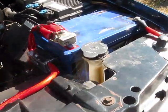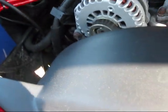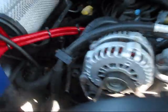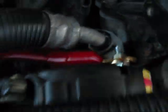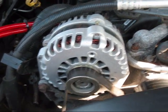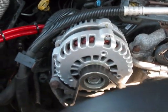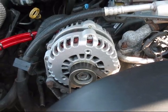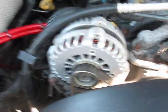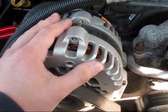I was lucky enough where my truck came with two battery trays because it was supposed to be a diesel model but they put the gasoline engine in it, so I lucked out and got a free battery tray. What I did was I ran two charge lines off of the back of my alternator. I upgraded my alternator to a 260 amp — this is only temporary. I'm going to have three 300 amp alternators in my truck. One alternator will charge two batteries. This alternator will always charge my front two batteries even when I upgrade to the 300 amp.